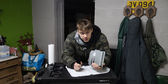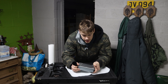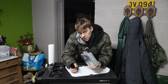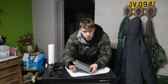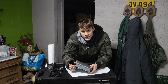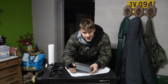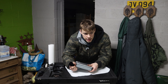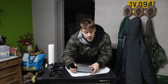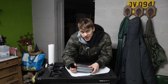Our ECU is back together. Unfortunately there were no visible signs of corrosion or anything that could have caused this, so we're back to square one. I'm just going to throw everything back together and air out the injector lines once more. This diagnostic process has been intense and unfortunately it hasn't led me anywhere — we found no explanation as to why the ECU is getting the wrong readout from the temperature sensor.